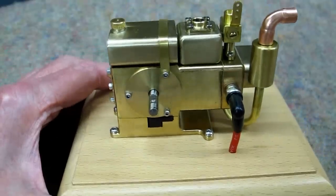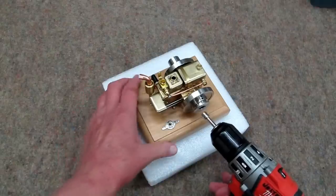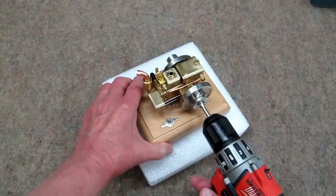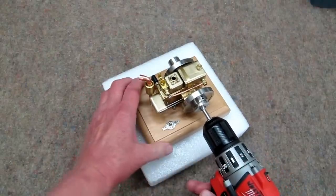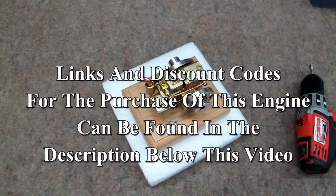This is really a very nicely made engine. I have the starting adapter in my cordless drill. Set your cordless to high speed, then briefly touch the top of the carburetor and choke a little fuel in there.